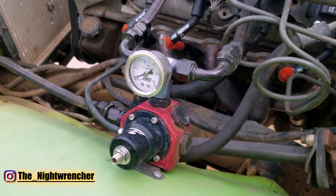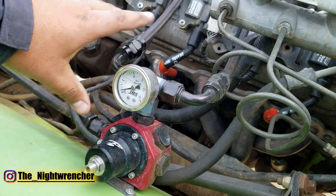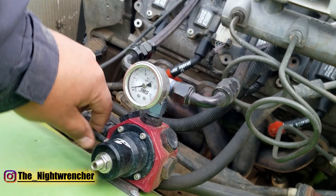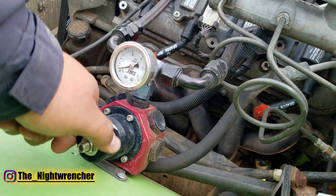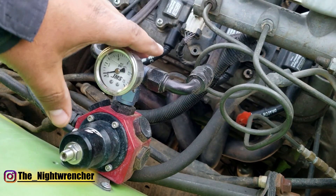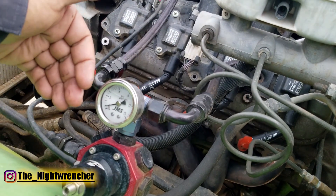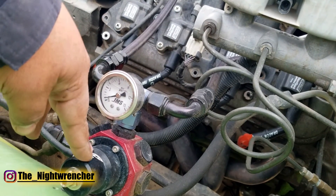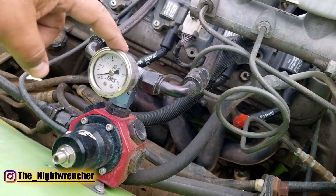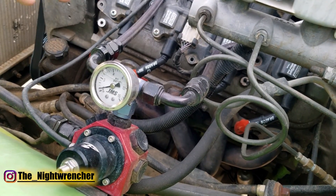In order to accomplish that you're going to need a fuel pressure regulator. This particular one is made by Aeromotive — link in the description — and it is a boost-referenced fuel pressure regulator. On a naturally aspirated engine, a similar line adds fuel pressure when the engine sees low vacuum to prevent fuel starvation at high RPM. For a boost-reference application it adds 1 psi of fuel pressure per pound of boost. However, if the fuel pump can only support 10 pounds of fuel pressure, this regulator maxes out at 10 pounds — there's nothing it can do beyond that.